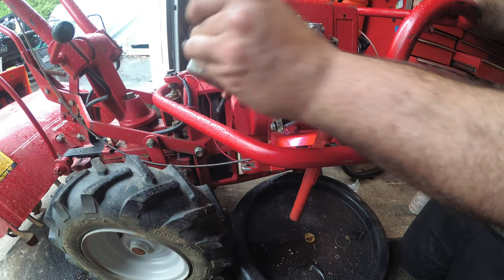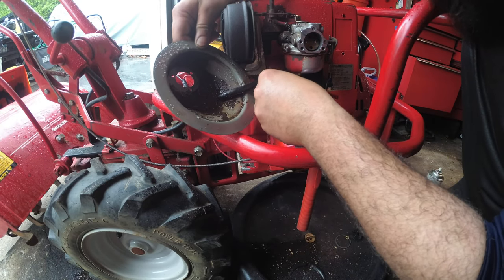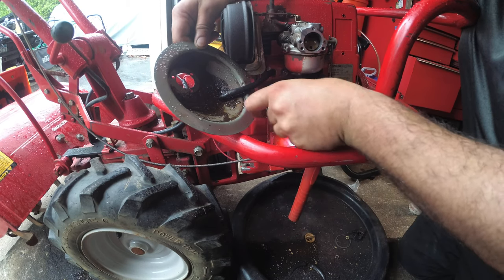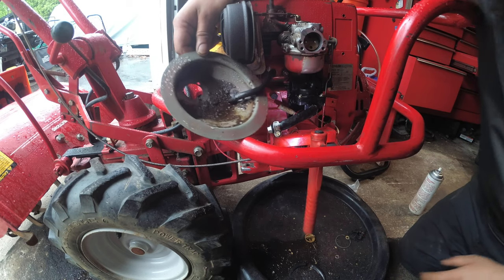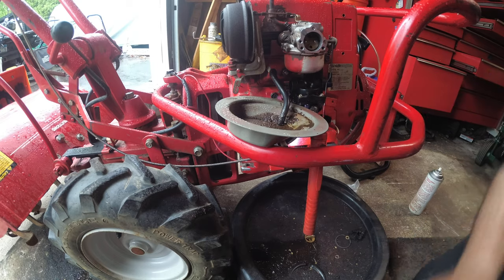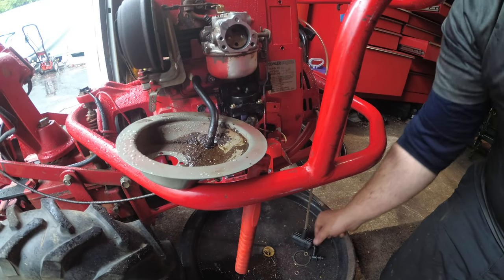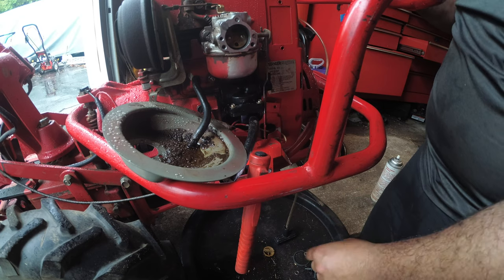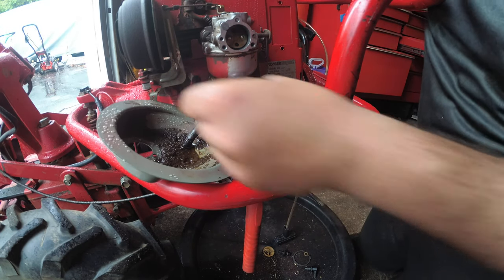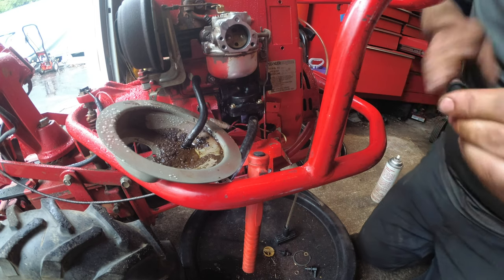And let's just see with our fuel on. Get this crank vent out of the way. Alright, if we stick that here, is that gonna put an awkward bend on the fuel? If we just do a 90. Or if we just go straight, then they'll interfere with the spring. So it's just going to be a 90 degree, facing out just like the factory. Alright, let's do that.